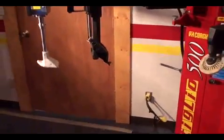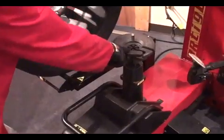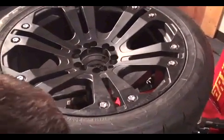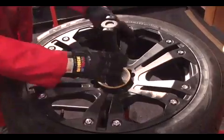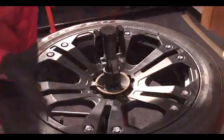Okay, now we can grab our wheel. You can see I have my lifter here, that really helps. I'm going to place this pin in one of the lug nut holes — doesn't matter which one. This way I don't have to over-tighten with the handle because that pin will keep it from slipping on the turntable. So, down and lock it.